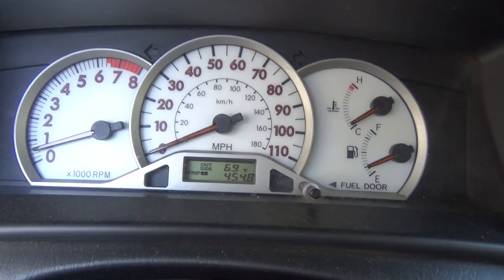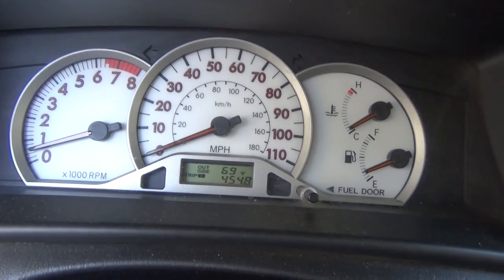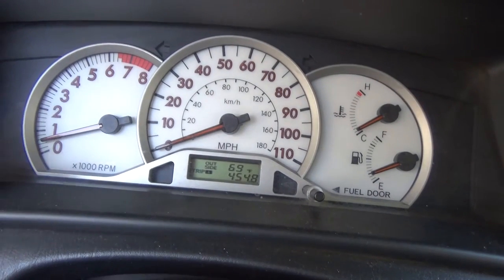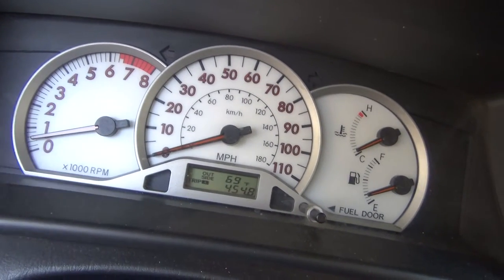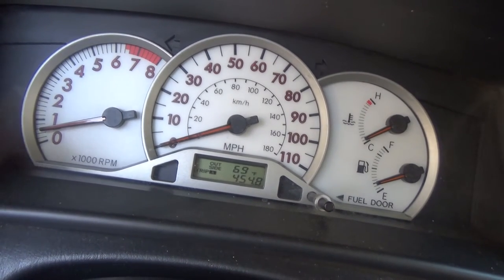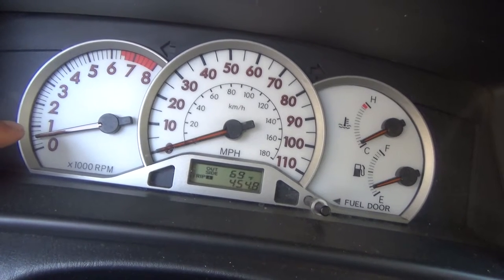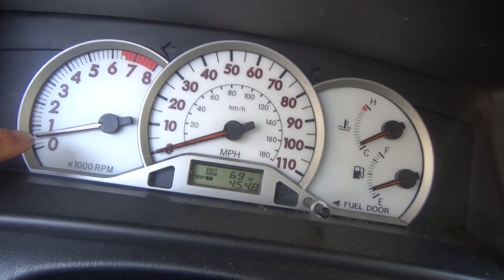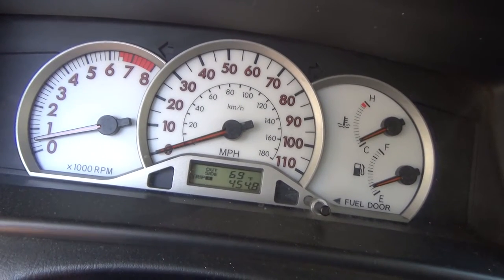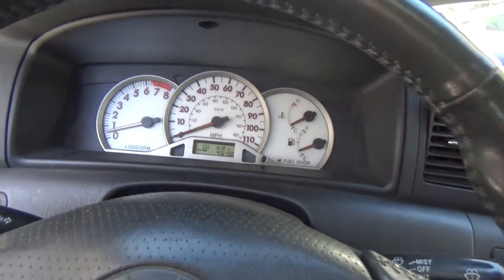It's been about five minutes and my engine is a little bit warmer — you can see the temperature rising. But now the RPM is about 500. I've never seen my RPM go that low. Usually when it's idling it's around 1000, pointing at number one, but now it's pointing at 500 RPM — that's half of what it usually is. And my car is shaking really bad.